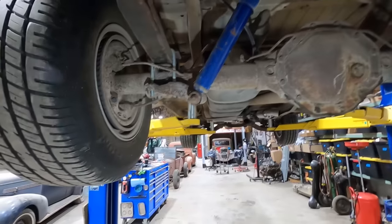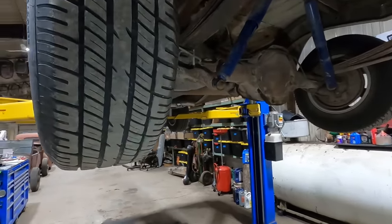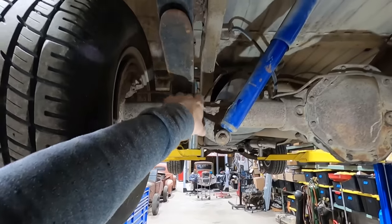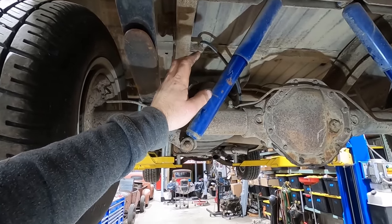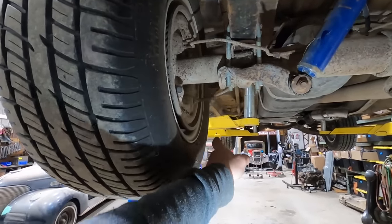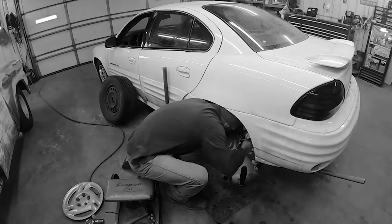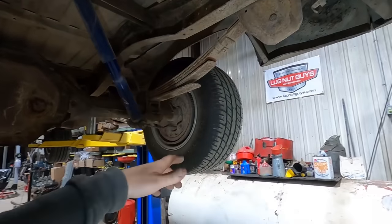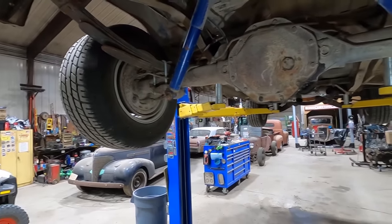All right, first things first, I think let's take the wheels and tires off the back, and then we'll take these shocks off, and then start taking U-bolts off. I wish we had a brake hose. We'll get one of those coming because we're going to have to take it loose anyway, so we got to bleed them. Might as well put a new one on. Or we'll probably just cut these park brake cables because that's what we do. And then drop this leaf spring down, figure out how to drop this one down, set the rear end on top of it. Carry on, easy peasy, lemon squeezy.